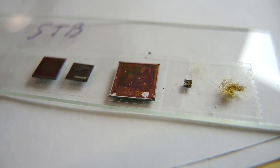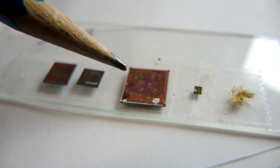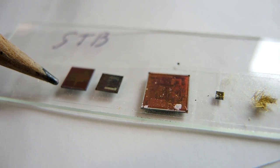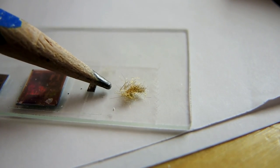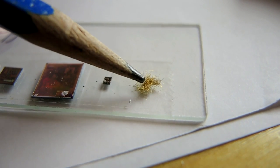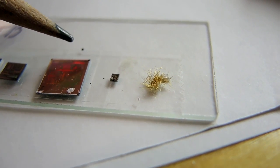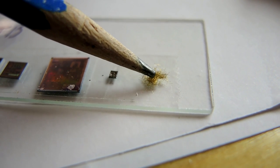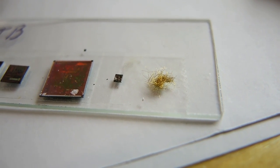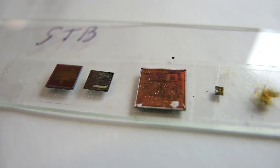Here we have all the integrated circuits. The very smallest die is that little SOIC under the metal can. This is the video processing die. These two chips — I'm not sure what they are, but I'm pretty certain they're dealing with intermediate frequency. And this little pile over here that looks like a little bundle of gold — that's exactly what it is. There are a lot of bond wires in these integrated circuits, and gold is a very common bond wire even in today's products. People do go through old electronics trying to recover it, because if you take enough electronics apart you can actually get a meaningful amount of gold.